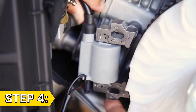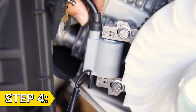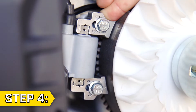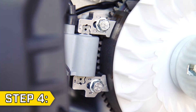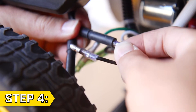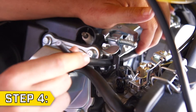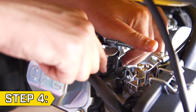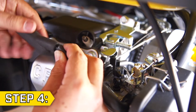Step four. Place your new ignition coil around the flywheel and loosely replace the two bolts. Push the ignition coil as far from the flywheel as possible and tighten both bolts. Run the wire connectors back through the crankcase to underneath the panel and reconnect the color matched wire connectors. Then carefully feed the spark plug wire back through to its appropriate location. Make sure you secure the wire back into the tabs on the insulator and reattach the spark plug cap.